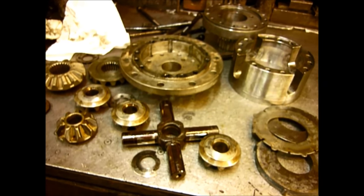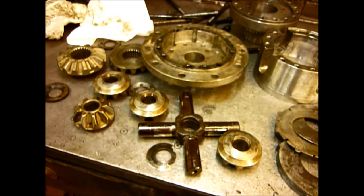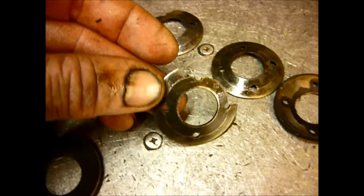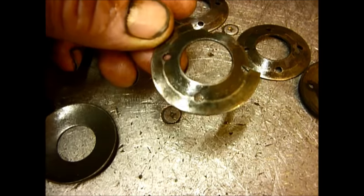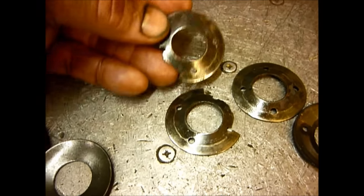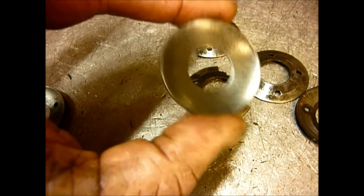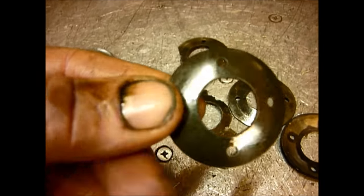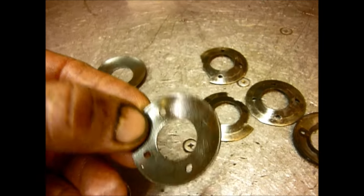These lockers are pretty Neanderthal. The Achilles heel is the long bolts when you undo them, and worse, the bearing on the end being a special. Looking at the thrust washers that came out of this diff, you can see cracks forming where they almost join the centres of the four little holes together. These were the earlier Cam-type thrust washers and it is a known fault. What we can do — and luckily I have them — is replace them with solid ones without holes, which don't crack. I also have some of the new ones with four holes in, but those are going to crack, so I'm not sure what I'll do with those.